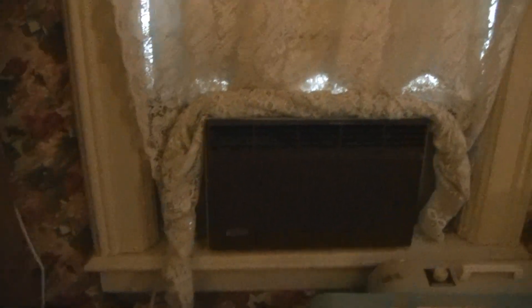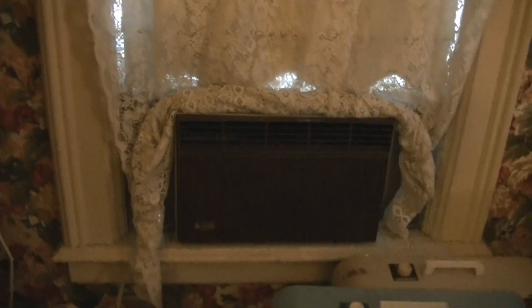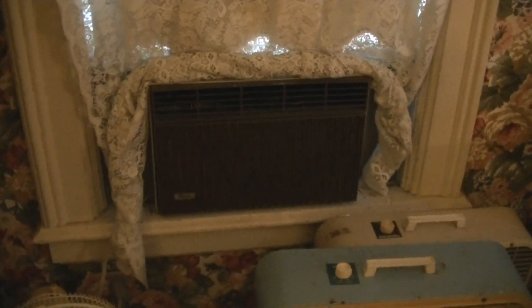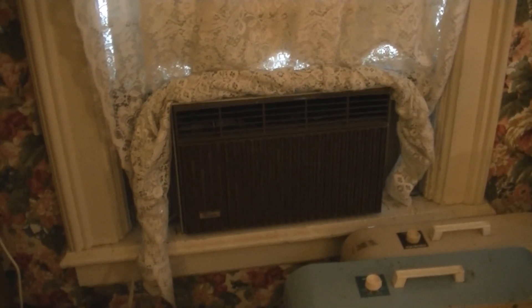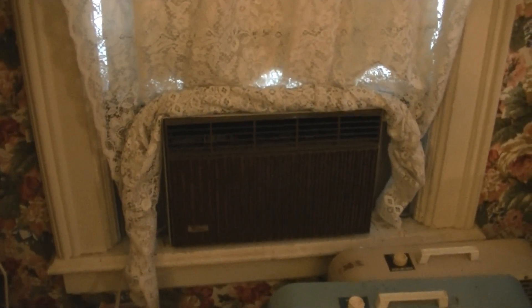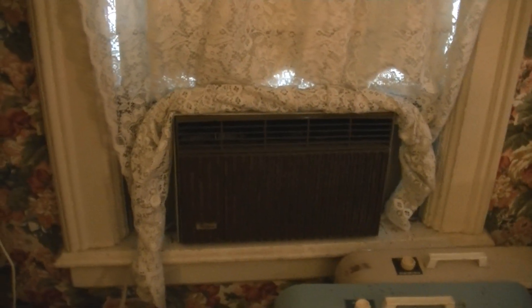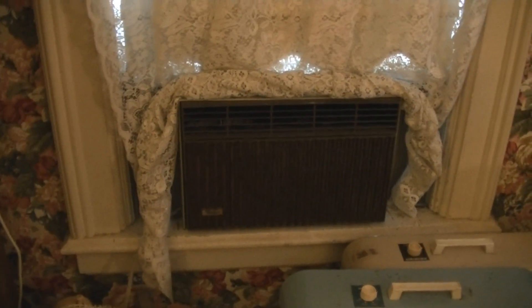The question of whether or not this Whirlpool air conditioner leaked refrigerant has officially been answered. I turned it on last night, it was working alright at first, and then woke up later in the night and the compressor was still running, but it was just making a continuous loud hissing noise — not a normal hissing noise you'd get out of one of these. So that means either the compressor is not compressing properly, or much more likely it just lost refrigerant. It must have been a really, really slow leak, because it worked fine for quite a while.